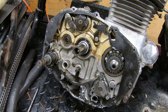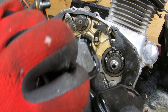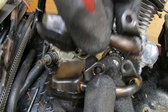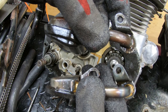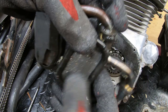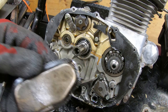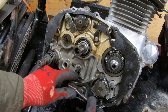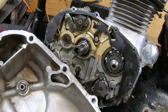Who knows how long it had been since an oil change. This one is noticeably longer with the same mounts, so they both sit in the engine the same way. I think what traditionally happened: when the bike was low on oil and on the side kickstand, the shorter pickup sometimes wouldn't pick up any oil at all. I'm gonna take that top off and just make sure we're clean underneath.